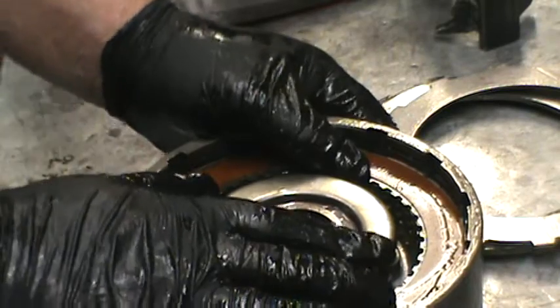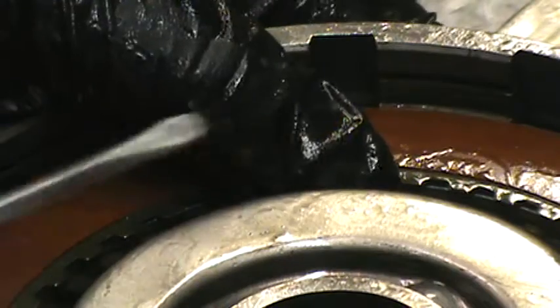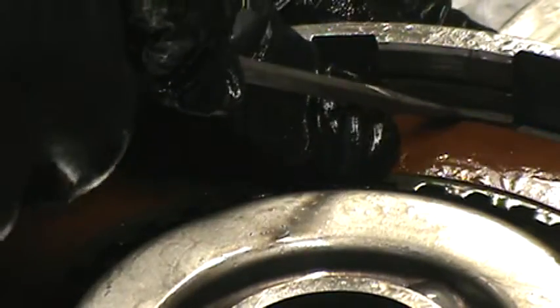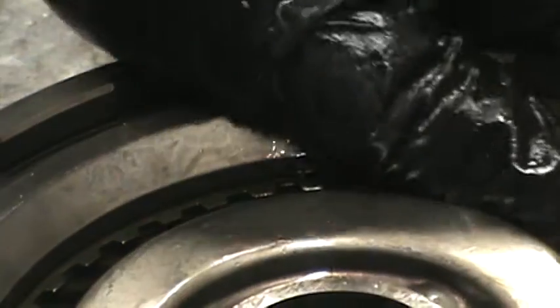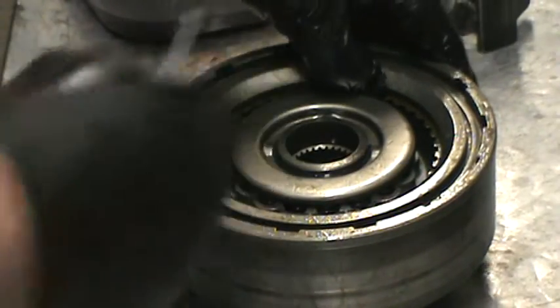What I'm looking for is to see some steel back in that golden area right here. I'm not seeing it, so I'm going the other way. Let's take out that direct and put in another forward steel — let's take even more out of the clutch pack. Now I'm seeing that gap right here, that's what I want. This spins a lot better. What you're doing is leaving gap in there for the clutches to slip, oil to flow past for lubrication and cooling.